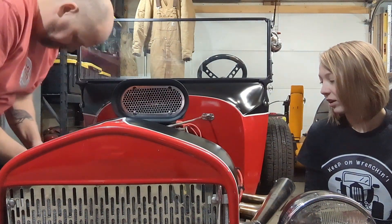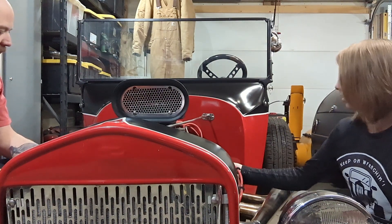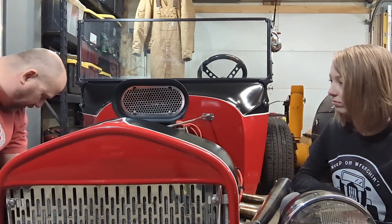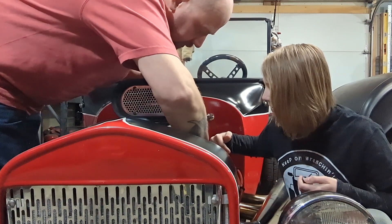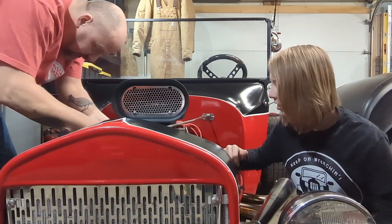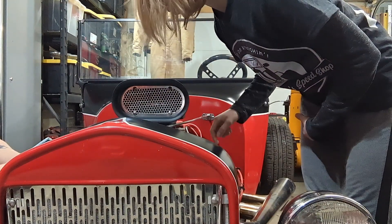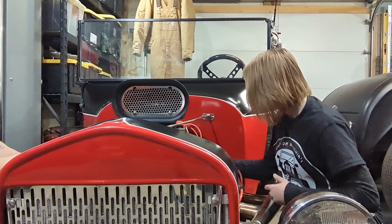What's next? The spark plug wires. These all look pretty new — they don't look cracked, they don't look weathered, they look just fine. The starter down here — the wires are all brand new, nothing's loose. The fuel pump is not leaking at all, and neither is the water pump or radiator. Wait — I just noticed something right here: we've got a little bit of oil leaking in the valley. We should probably check the other side — I bet we've got some loose intake bolts, we better tighten those up. And over here it looks like it's a valve cover gasket leak too.